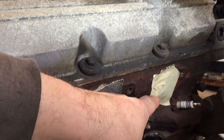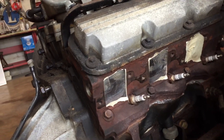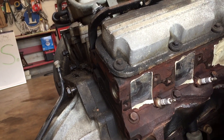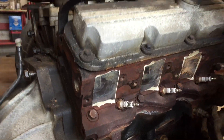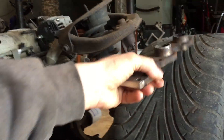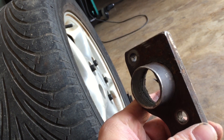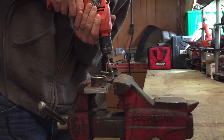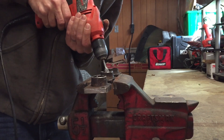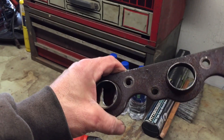I'm putting a piece of masking tape and then a piece of foil tape over the masking tape — hopefully that'll prevent any spatter balls from melting onto my valves. Got both sides taped up. Now I'm gonna stick the flange back on. I just need to clean up the inside lip of these a little bit, then we'll stick them back on and start mocking them up.